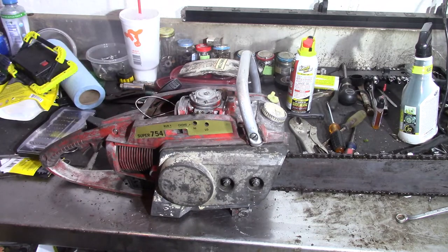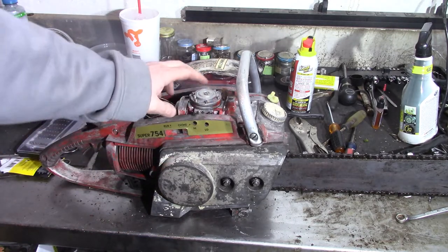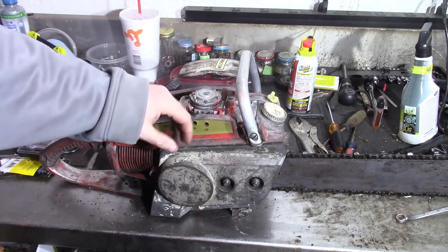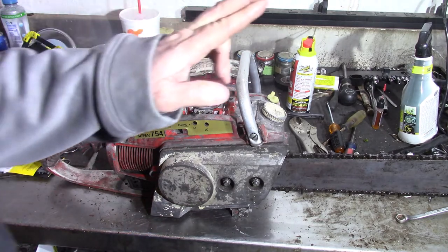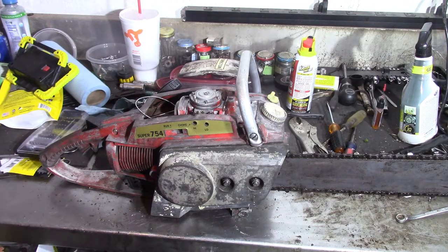I'm hoping it runs because I definitely can't spare the 30 dollars right now for a rebuild kit for the carb. I took the top off — it actually separates: the top part comes off and then this piece here comes off also. I got all that off to make sure everything was good and clean, gaskets everything looked good, got all that put back together. Fingers crossed, we'll get it out there. If it's not raining tomorrow and I get some daylight when I get home from work...